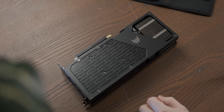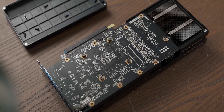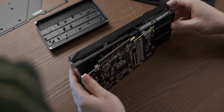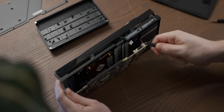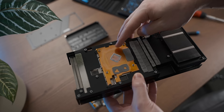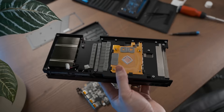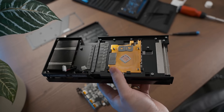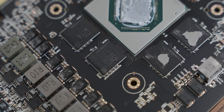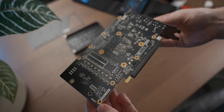It's finally time to tear down our Hannah Montana graphics card. You just lift that off, and then there are a couple more screws hiding underneath here — so many connectors. We've got a copper contact plate which not only touches the GPU but also the memory, and there's a lot of thermal pad making contact with the power delivery. There are four medium sized heat pipes — it is quite a hefty cooler. Considering that this is just a 7600, I'm sure temperatures are going to be fine. That 7600 die has a surprising amount of chrome bling on it. Next to that we've got eight gigs of video memory and a power delivery that's not a complete abomination — for the price you kind of hope it's not completely bare bones.